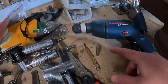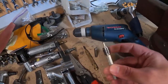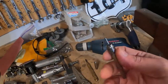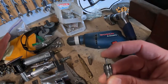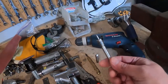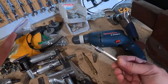Actually I recommend the $5 spot weld cutters from Harbor Freight instead. They're reversible — you can spin off the tip, flip it around, retighten, and you've got another fresh cutter on the same bit. The only downside is the tip wobbles a bit so you have to be careful at higher RPMs. But for five bucks, if you get 10 of them you can get 20 to 50 spot welds each as long as you're not overheating the tool.